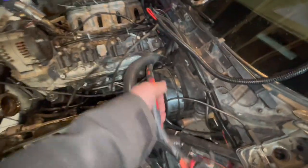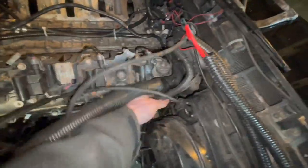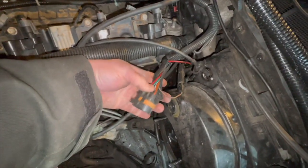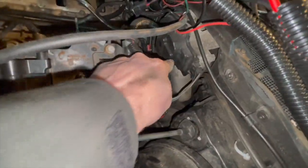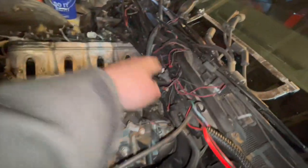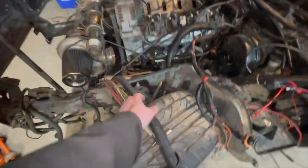I'm going to be able to get rid of this whole connector. The thing is I can't just rip it off the firewall and throw it away, because there are things that split off of it. Right here off the bat is your fuel relay connector, which I don't need anymore. But one thing I do need is my wiper motor, which goes in here. There's also miscellaneous items like the blower — the HVAC blower is in there — and I'm going to want to save that. I'll have to pull it apart, separate it, and resleeve it in new loom because this is just oil-saturated.